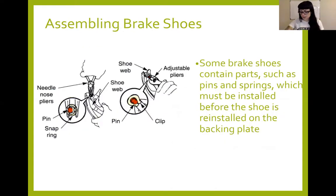When you are assembling your brake shoes, some of them will have clips that hold the parking brake assembly or other pieces. A lot of times we'll use a little e-clip or a horseshoe clip. I will show you guys in the lab how to dismantle those — they're actually super easy. You're supposed to replace them every single time. If you can't get a hold of a new clip, you can use pliers to squeeze them back together. Sometimes they're spring loaded, sometimes they'll actually move.